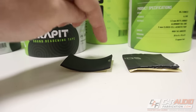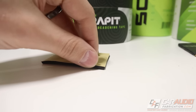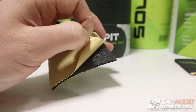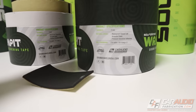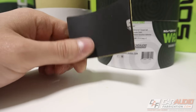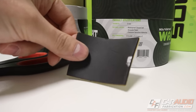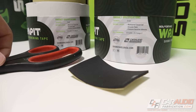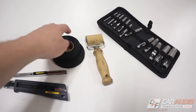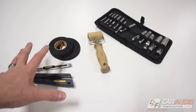This tape is basically just the acoustic foam from the original SoundShield material — it does not have a butyl rubber layer, it's just the foam, but what's also super cool is it has the pressure sensitive adhesive. I'm pretty excited about this product because I actually helped these guys pioneer it, and it's really going to come in handy for separating wire harnesses and for tackling other areas of the build where we have components rattling together. This acts as a decoupler. Along with all the SoundShield materials we'll also be using a couple of different knives, some cloth automotive tapes, and some different specialty tools.